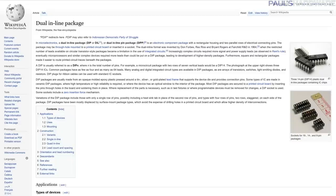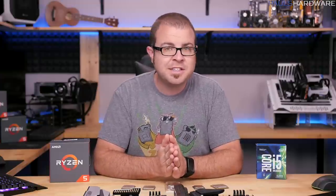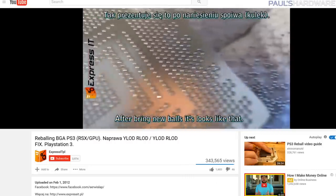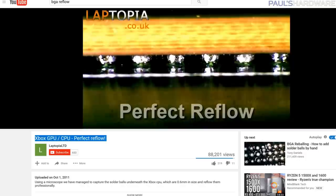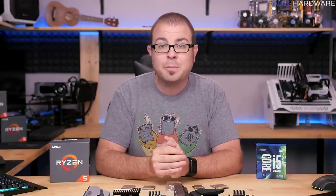There are other ways to surface mount a component onto a motherboard or PCB. While I won't delve into older configurations like dual inline package, chip carrier, or the slot mounts that Pentium 2s and 3s used, I did want to quickly mention BGA, or Ball Grid Array. This is how CPUs and GPUs are usually installed in laptops and consoles, which aren't meant to be end-user serviceable. Like PGA and LGA, BGA has a specific number of contact points between the chip and the board, but Ball Grid Array uses tiny balls of solder instead of pins or pads — these are aligned on the chip and then reflowed, or heated up to the point where they melt and secure the chip to the board. This is usually done with specialized equipment, and is not recommended for most home builders, but now if you hear BGA you'll know what that means.